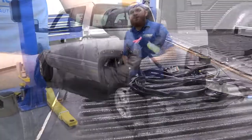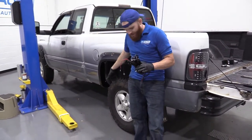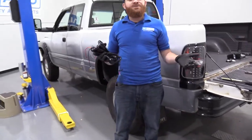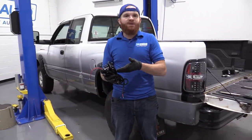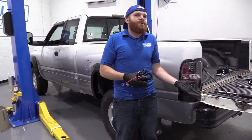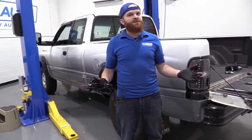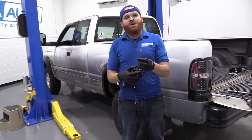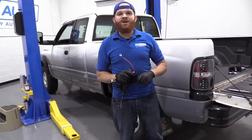Do the same to this one. The wiring that goes from the front all the way up by the battery, down and under, along the frame, and all the way over to the other side just isn't quite long enough. That's bound to happen — maybe they weren't really planning on people putting pods in the back of their truck. So we're going to do something simple: get ourselves a little bit of extension wire, approximately the same gauge as what we have.